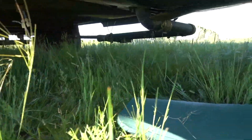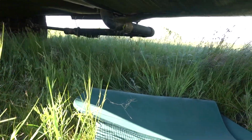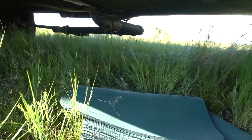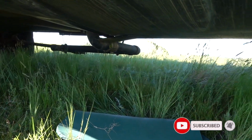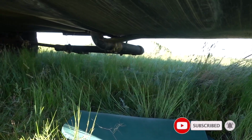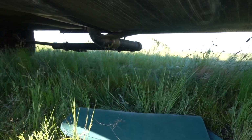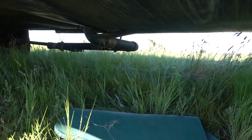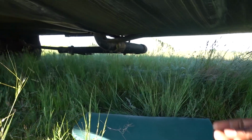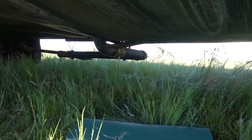So you probably saw that I keep having trouble when it comes to my valves. I had to replace all my valves on this RV, and my black tank valve has been replaced 3 times. You heard that correctly, 3 times. The first time it went out, I couldn't get the valve to open. The second time, I just replaced it because I got my black tank replaced, and I figured why not just do it again. And somehow, some way, that valve got jammed, and the rubber seal was allowing black tank water to leak into my underbelly.